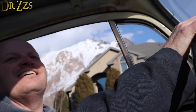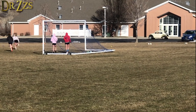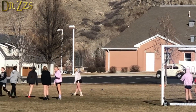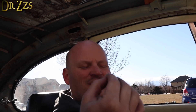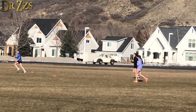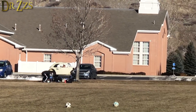We're driving. We're going to go to the church. We did a lot of work on the suspension — we put in spring reinforced shocks anticipating a heavier load than the original shocks were meant to carry. We also put in new steering rods and we put disc brakes on the front wheels. We're going to try it in third gear. The car does ride a little lower in the back than in the front right now. This motor is a little heavier than the original Volkswagen motor, and I've got my battery pack in the back of the car — I'm sure that's why it's sitting a little lower in the back.